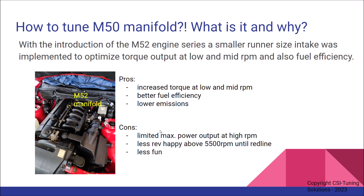On the negative side, this small intake with the long skinny runners does limit the max power output at high RPM, meaning the engine is more or less choked above a certain RPM and power limited due to the intake. It's a little less rev-happy above around 5,500 RPM — it really starts to drop fast and you can feel that something is restricting it, acting as a limiter.